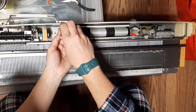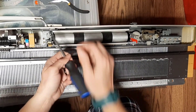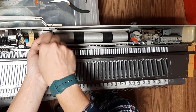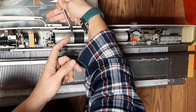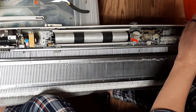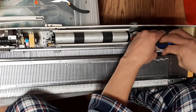There are a few screws you need to remove: one here, one here, one here. You also need to loosen the two screws that hold the handle, otherwise you won't be able to get this module out. There is another screw here, beside the big dial.